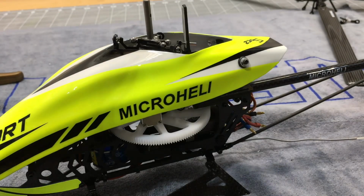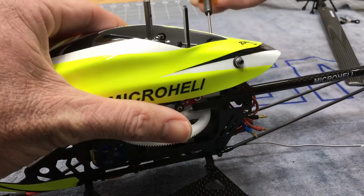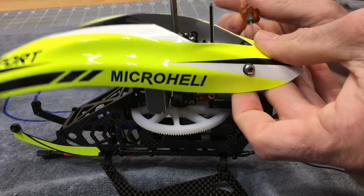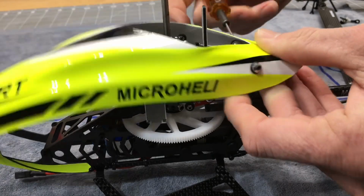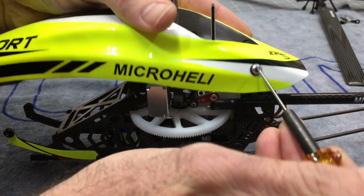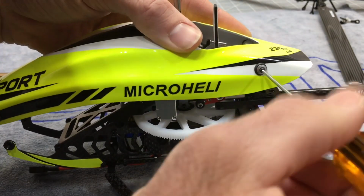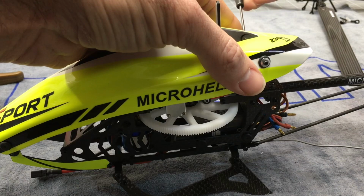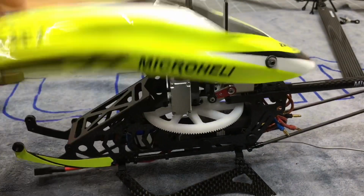Do the other side first. The side, go through the grommet. And you tighten these 2 screws down, which is fighting me, so just got to get it started. To get one started, you can go ahead and get the other one started. But you just need to wiggle the grommet till you get the thread started. There we go. Threads are started. Go ahead and tighten those down. Again, make sure you got Loctite, but you don't want them too tight. You still want the canopy to swivel up and down.